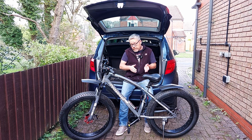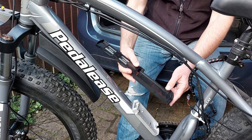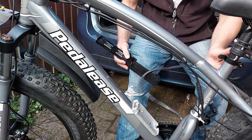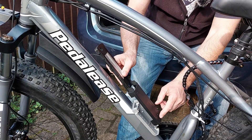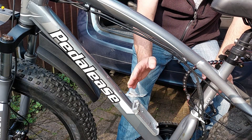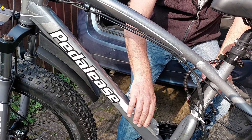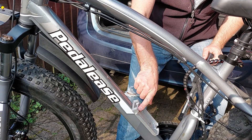This piece here comes off the bottom of the battery, and this is where it sits in. The wire goes in there like that. On this particular bike the two rivnuts for putting a water bottle on were down here, so I took the three screws out and removed this. I measured it all, made sure there was enough room for the battery to slide in at an angle, measured the centers and the width, then drilled two holes in this metal bracket here and put two bolts in.